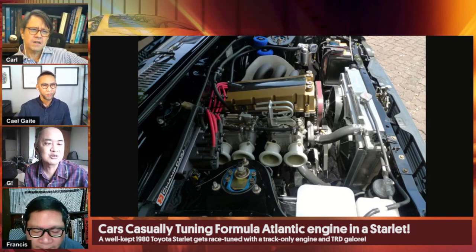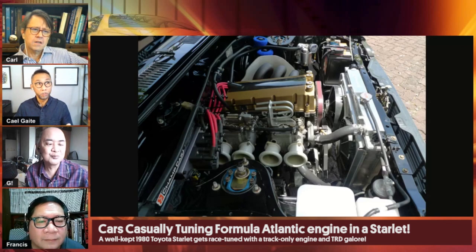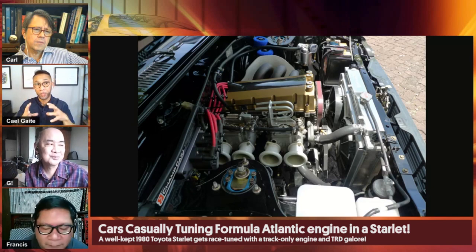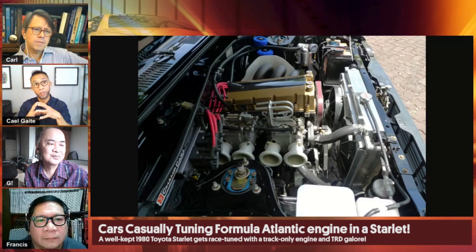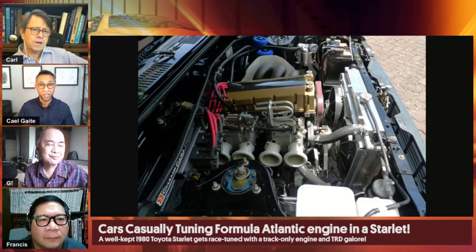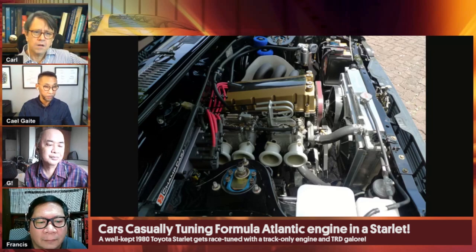You don't need a traditional transmission anymore. Because the problem is with these old cars, how do you retrofit a drivetrain from an electric motor? They don't have any. So what they do is they have an adapter plate that bolts onto the stock transmission. No need for clutch. You put it in gear, you drive it away, you can shift it to another gear, and because the electric motor spins to what? You know, endless RPMs, right? Yes. So a lot of these electric EV cars, these Porsches, VW Beetles, they have the transmission in place.